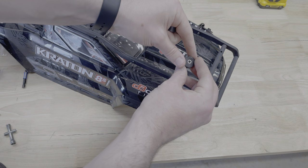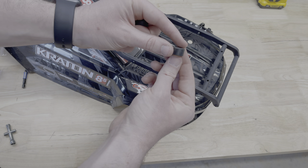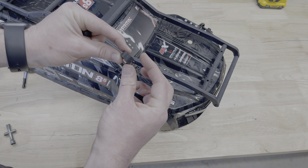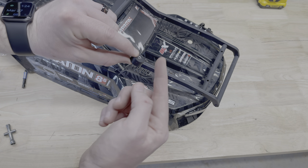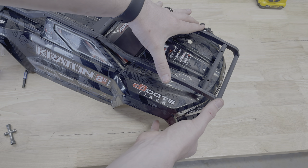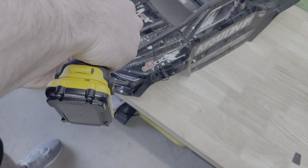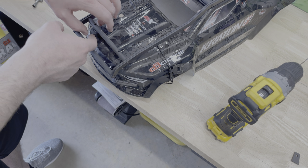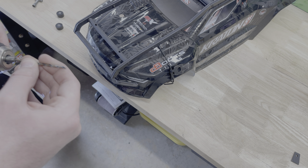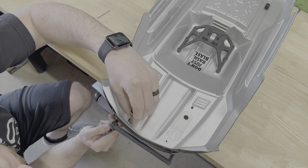For the front it's going to be a little bit different. We have to make sure we're not pushing this down too far, otherwise it won't be properly aligned with the rubber spacer. We also have to make sure the thicker side of the rubber piece is oriented towards the front, because that will keep the hole more straight up and down. We'll put those in place, lower this down, make sure it looks good, then drill the hole. From here we can just remove these, mark where the hole is, swap out the bit, and drill.